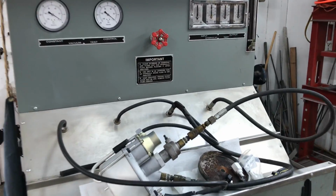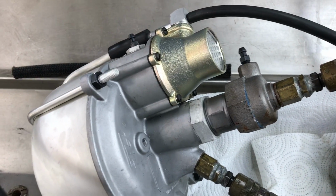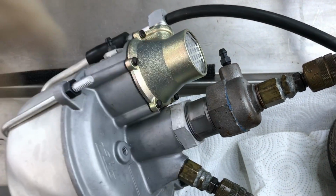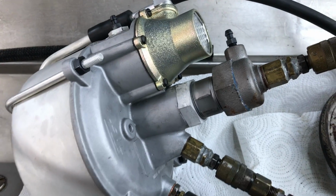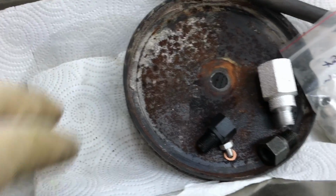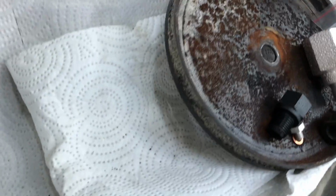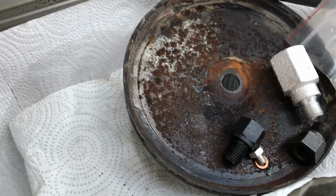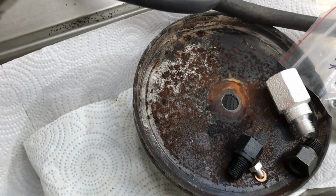Oh, Tom, got your T50 booster ready to test, and as you know, we got you old school here, which is correct for your car, and original to the fact that this has got a leather diaphragm in it. And I converted it for you because the diaphragm that had been installed in there was shot and not technically correct for your car.